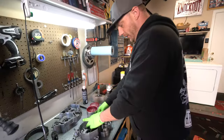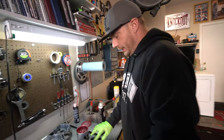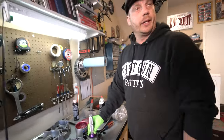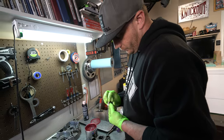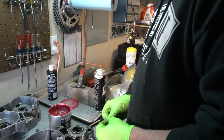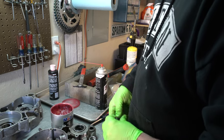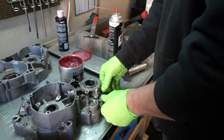What was happening is I was pushing with my finger and it was reaching a sweet spot where it was just dropping away. So to get it seated evenly, the surface of the driver is bigger than the surface I'm pressing on — it bottoms out against the case so it's nice and even. That's what we want. Same thing with this one — this is the shifter arm seal. This is what actually moves the detent inside and shifts the transmission. This one can start weeping and leave oil all around the chain.